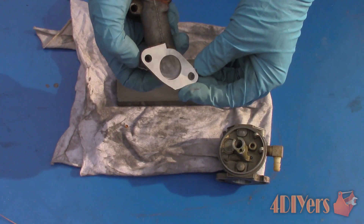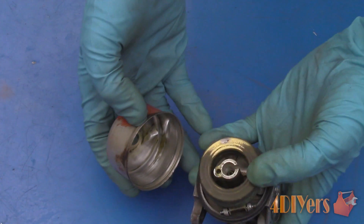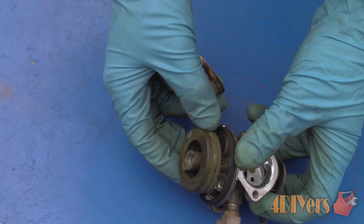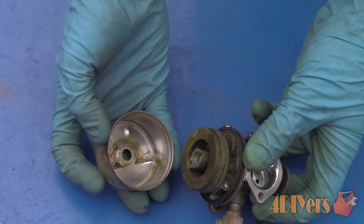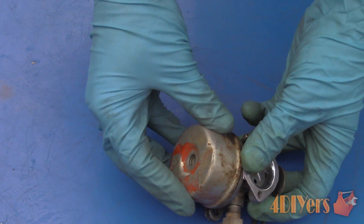As for the new paper gasket, you can purchase new ones or make your own — be sure to check out my tutorial on that in the description below. Give the unit a final spray down and clean the adjustment needles as well, then allow everything to dry. Be sure to install the float bowl in the correct orientation as it won't function properly. The float must be able to swing down in the lower portion of the float bowl; if not, the unit won't get a sufficient amount of fuel, which is controlled by the needle.